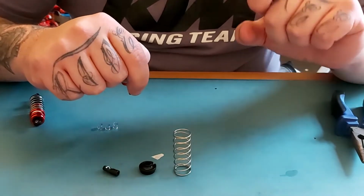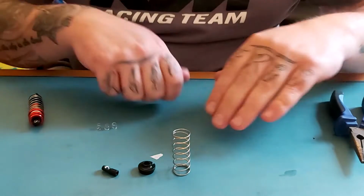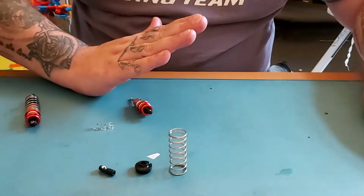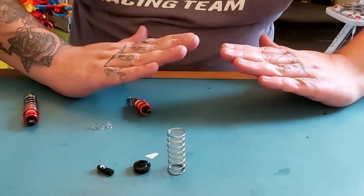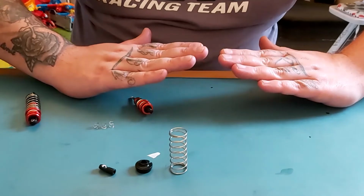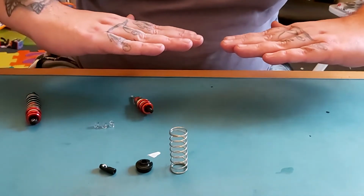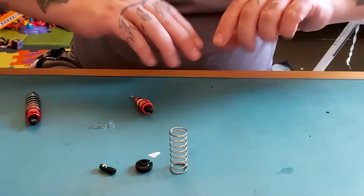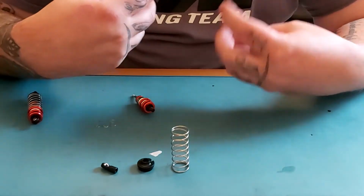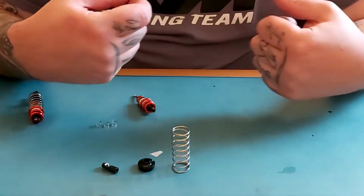This can be quite helpful for cars that don't have suspension links with the droop screw in, and no facility to put a screw in to touch the chassis to raise the leg up. Like the Wltoys A959 and I think the 979, they're set as they are. So your dog bones are sat like that, where you want them raised up more so it's a smoother experience and you don't lose any speed. It's easier on the motor, it's easier on the dog bones, easier on your diff cups, drive shafts, everything.